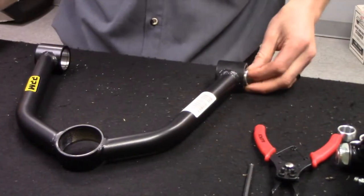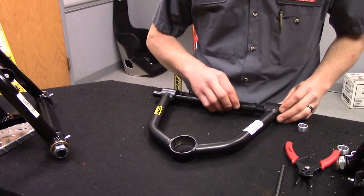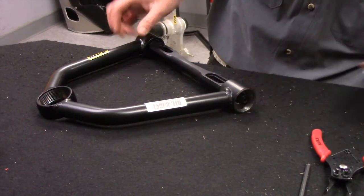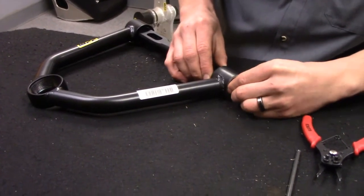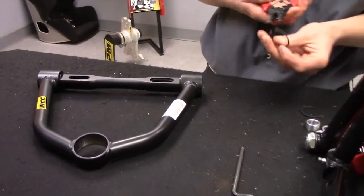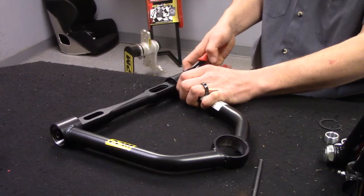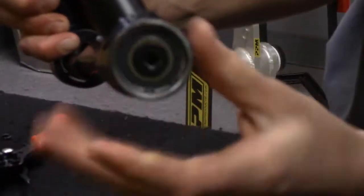What I like to do is take the shaft and slide that in there like that, then slide the little spacer bushing in there, and then put another bearing. There are two bearings on each side with a spacer bushing in between the bearings, and then I put the little snap ring in, which holds and retains the bearings and the bushing.